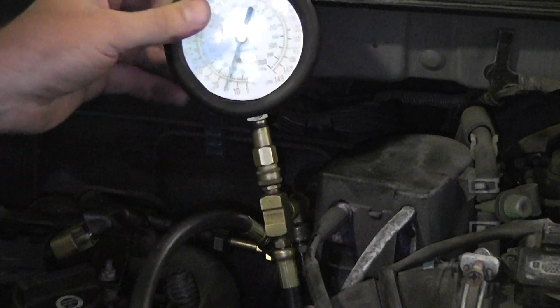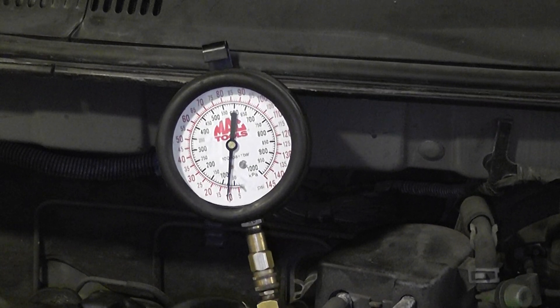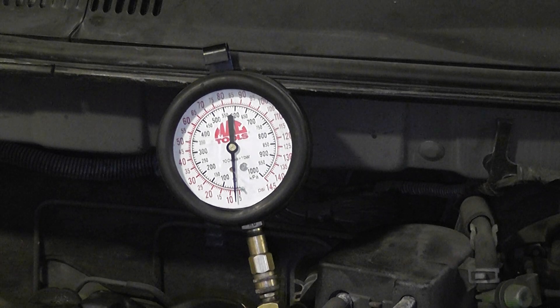You see the gauge drop — go ahead and crank it again. Let's make sure the fuel pump is not running. Good. That is a critical step to make sure you disabled the pump. That would be more critical if you're blocking off fuel lines — you don't want to block a fuel line and not disable the pump; you'll ruin that pump. Also, some of these circuits share power feed between the fuel pump and the fuel injectors, which would be a problem — I need my injectors to fire during this process because we need fuel entering the engine. On some cars you have to crawl underneath and disconnect the fuel pump at the tank because of shared circuitry. In our case we're good — pump is disabled.